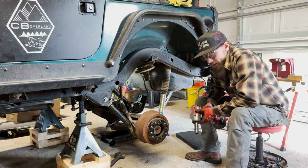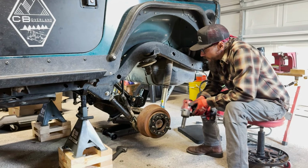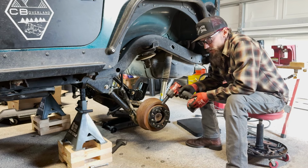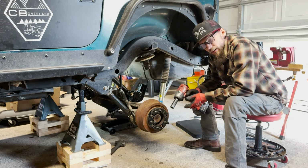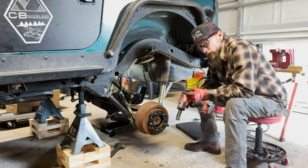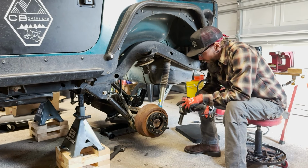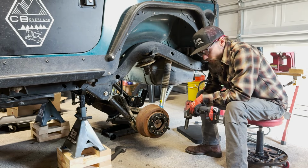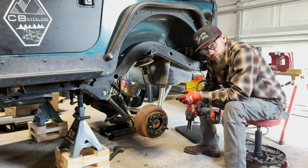All right. On to our next set of inspection for the rear end. I'll move on to brakes and then servicing our wheel spacers too. I've run these wheel spacers for a long time and they take a lot of maintenance. You just want to make sure you crack them loose every now and again and reapply some Loctite and torque them appropriately. But we're also going to get in here and inspect the inside of the drum and our brake assemblies and see what we've got left.